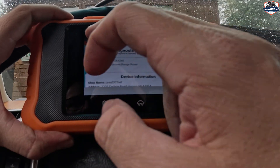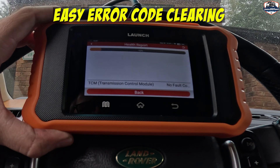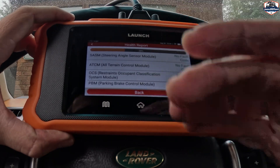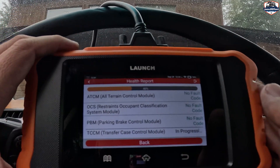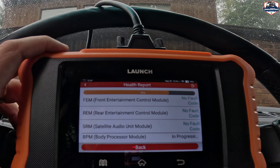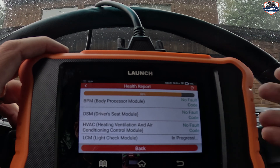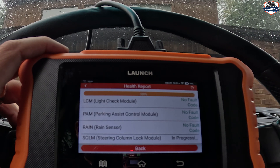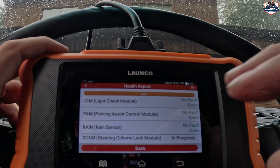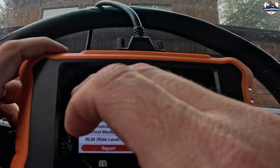This is also great if you're looking at a used vehicle. I'm going to go ahead and clear all of the codes, because I want to see what happens with the battery staying constant as I drive. This car was sitting for quite some time. So very quickly, I'm basically going to clear everything — nothing is going to be in the memory, and then I can really begin to diagnose what pops up. Out of the gate: it's battery powered, you can download the latest module and updates, you can run a professional-looking report that you can send yourself from the device because it has internet connectivity, and you can clear codes in seconds. At all points you can see your battery voltage at the top.